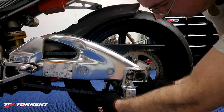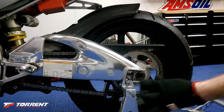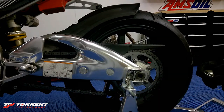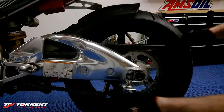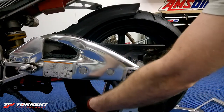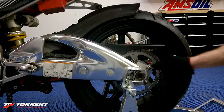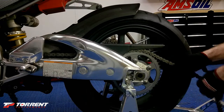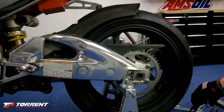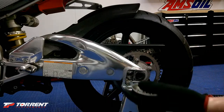Be careful because this is an O-ring chain that I put on here. There are O-rings on there and you want to save those O-rings — try not to lose those. A lot of people don't have extra ones. So then you'll pull your master link off and that'll break the chain loose. I'm actually just going to pull the chain off. As always when I work on this, I've got a little metallic dish that I put all my stuff in so you don't lose it.